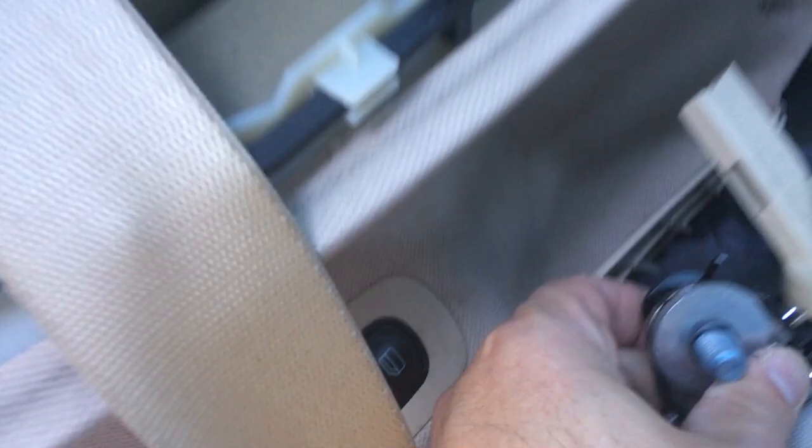I removed this retractor arm assembly - it's held on with a couple of 10 millimeter nuts. You're going to have this big bolt that anchors the seat belt, and that is a Torx 45. Once the seat belt anchor comes off, you can move things out of the way. Looking at this, here's our airbag - it looks like it's riveted in place and mounted on a stamped metal plate that's spot welded onto the metal inner assembly.